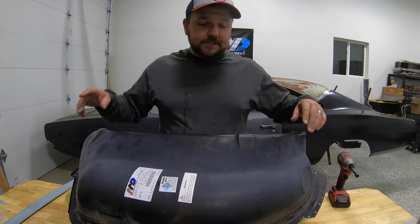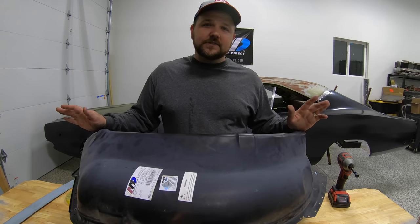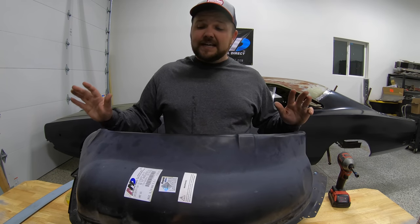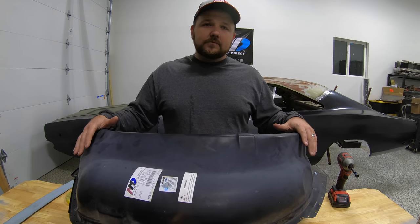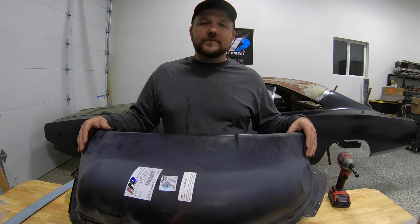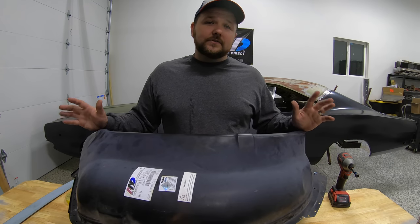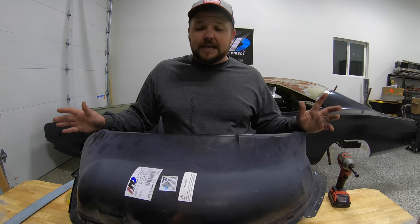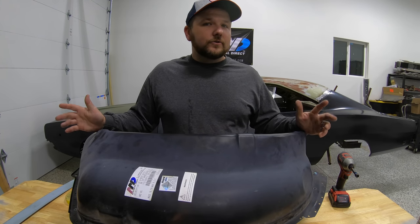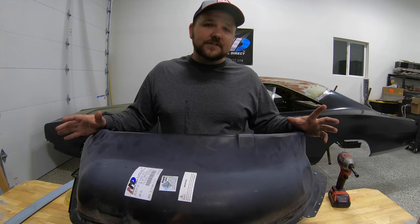But as you guys saw, we got the three holes lined up here that are on our wheelhouses. And then I did also bolt it to the car, so I've got really good reference that after we get done extending the wheelhouses 2.5 inches, bolt it all back together, screw it into the car. We're gonna have to do a little bit of trimming on our back seat pan, and then also on what's left of some of the inner metal that we're gonna have to do with the bracing and whatnot. But aside from that, it should be pretty straightforward, pretty easy to do, at least I hope. So let's get this unscrewed, and then let's start making some lines with our painter's tape.